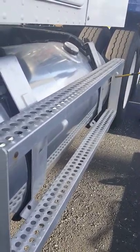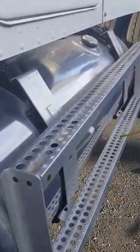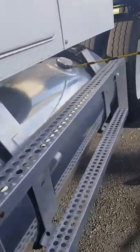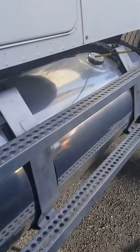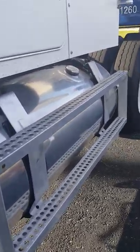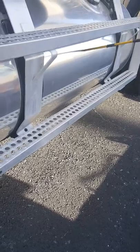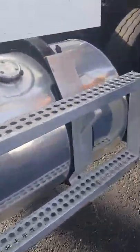My steps here again are properly mounted — not loose, no missing nuts or bolts, and no grease or oil that would cause me to slip or fall. My fuel tank cap is securely fastened and tight, there's no leakage around my cap, the cap seal appears to be working properly. Looking underneath my tank, I don't see any signs of leakage, and no dings, dents, holes, or damage to my fuel tank itself.